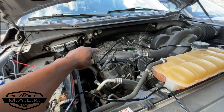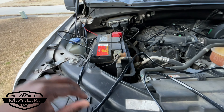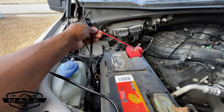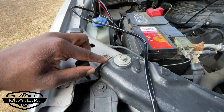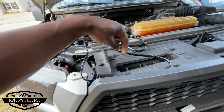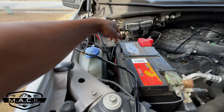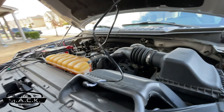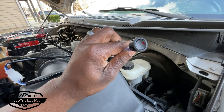Checking out the wiring harness: the red wire goes to your positive on the battery, and the negative goes to the battery negative or a chassis ground. The end of the harness goes down to the light bar — it'll run through the grille and plug into the light bar there. The other part of the harness needs to come all around and go into the cab of the truck to reach the switch.